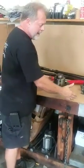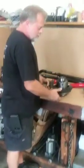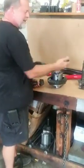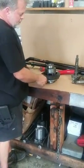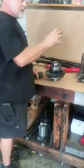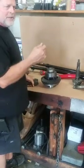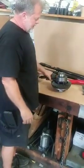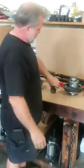Hence, it makes a bunch of powdery metallic residue in the bottom of your carrier, your open differential, that you have to pull out. That's why we change fluids after about 500 miles, because you have break-in material that you don't want to get into your bearings and your races after everything has been broken in. There's also an additive that's added into a posi or a limited slip clutch type differential that keeps it from chattering as it rotates and slips. It's basically a fish oil. It's a real thin lubricant that goes in this. It's a synthetic blend in a lot of ways, but basically gives it an anti-slip. All right? That's your basic break-in of a gear.